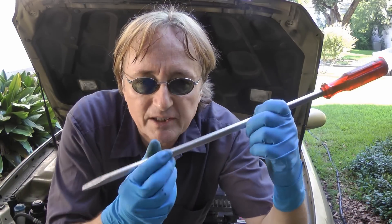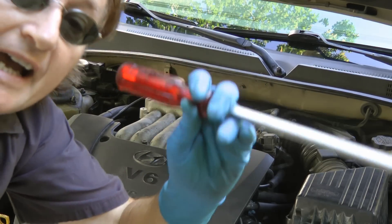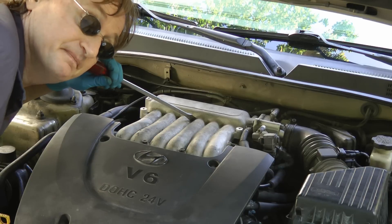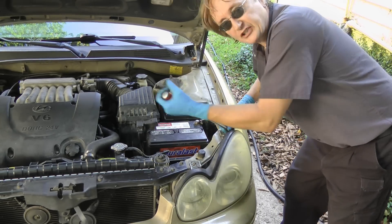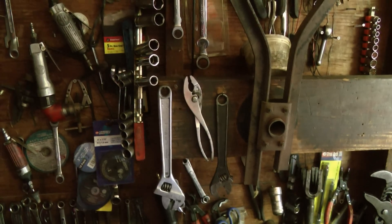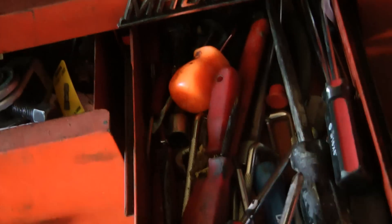Now another basic tool I advise buying is a giant screwdriver. It makes a great pry bar when you have to pry things off. And it makes a great listening device when you're trying to find the source of car noises. It's also a great emergency tool — let's say you get in a wreck and the fender's rubbing on the tire; you can get it in there and pry it away from the tire so you can at least drive home. And of course you want some basic hand tools like a good set of pliers and an assortment of different screwdrivers. You can buy those at any good discount auto parts store as a kit, like a handyman's tool kit, where you get them all together and don't have to pay the higher individual prices.